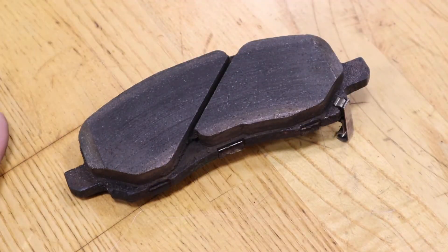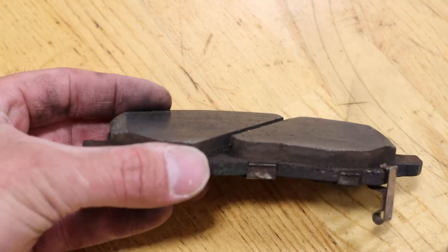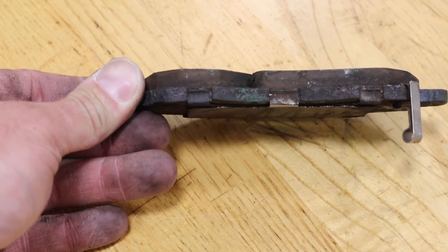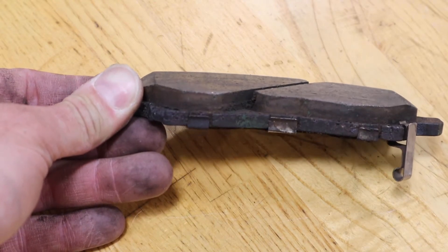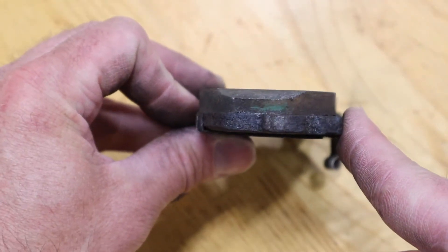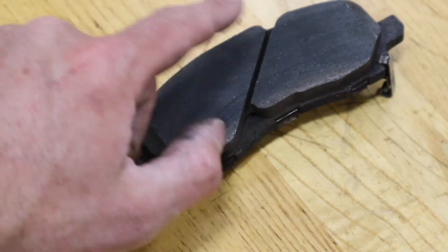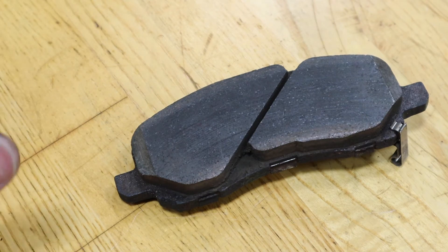The other thing I want to look for on my brake pad inspection is to make sure that these pads are wearing evenly. I want to look for taper in two directions: from this side to that side — some taper in that direction is normal because of the rotation of the rotor — and also taper in the other direction, which helps me understand whether these pads are being applied equally across the whole surface of the rotor. Any issues with taper in either direction could tell me about issues with my caliper slides or the ability for everything to move freely.